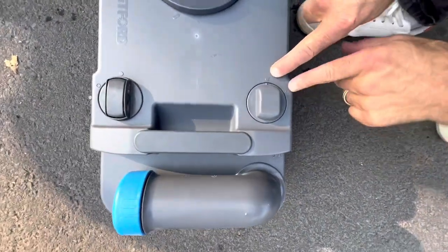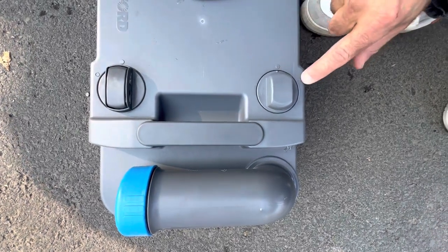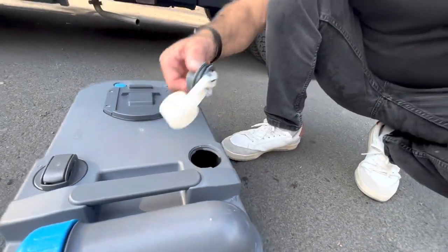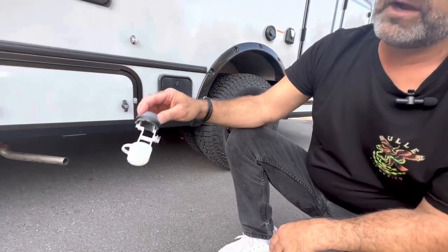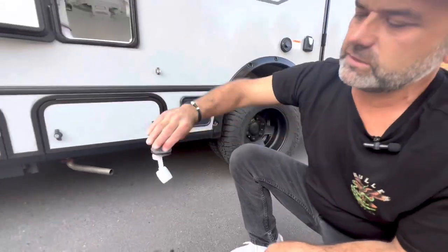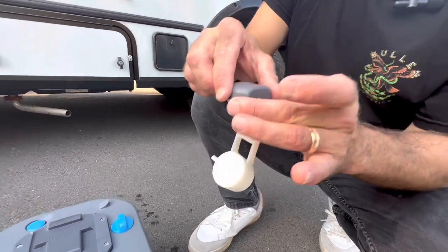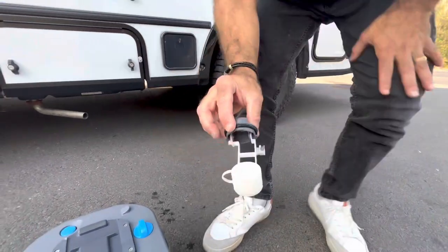Let's lock that back into place. Now coming over here we see the same indicator showing a locked position — solid circle and open. I'm going to go clockwise and pull out — look at that, it's a float. Those with some automotive background might remember these old floats on cars before we had all those electronic gas tank readings. There's a replaceable rubber seal and this float arm. This float arm is something you want to maintain every single time you empty the toilet.